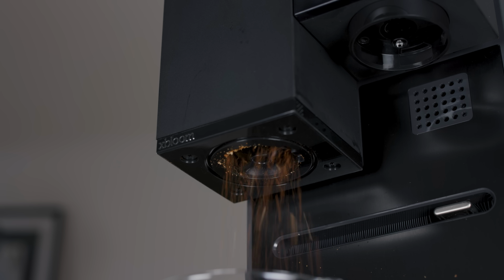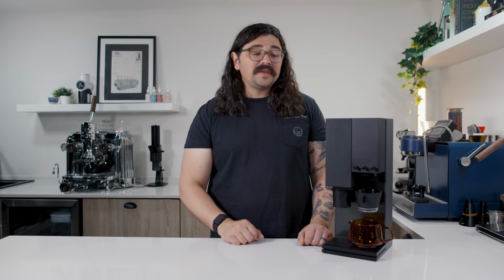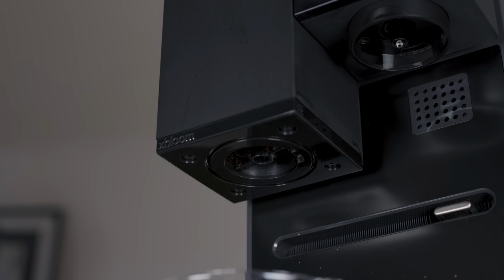Inside the grinder chamber is nylon reinforced with fiberglass, so it's very rigid in order to allow for that heavy torque that's being applied to the beans. Now, I have yet to stall anything even at the finest grind setting with really lightly roasted coffees, so it's kind of a great all-around burr that will accentuate light roasts really well, which was a goal of mine, and that's why we went with that heptagonal burr to begin with, is it has a slower feeding rate than something like a hexagonal or pentagonal, which are typical for darker roasted coffees. But of course, you can always up the RPM with the dark roasted coffees, produce a bit more fines, and you can have a bit more bold of a cup.